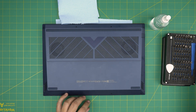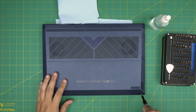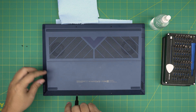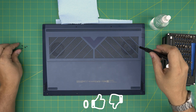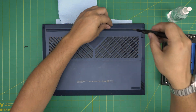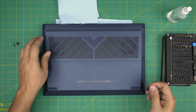Now we're going to remove a whole bunch of screws. We're going to remove four screws in the front row of the laptop and four screws at the back row. Go ahead and remove them and keep them in one pile, as all the screws are the same size and height, so don't worry about mismatching them. If you find my videos helpful, you can support the channel by clicking like and subscribe — I greatly appreciate it, it helps motivate me to make more videos.